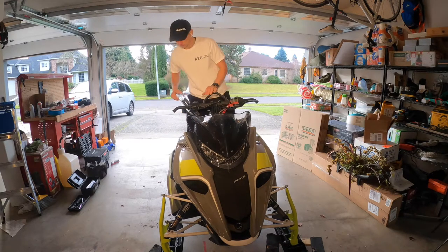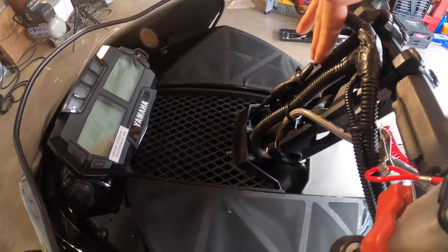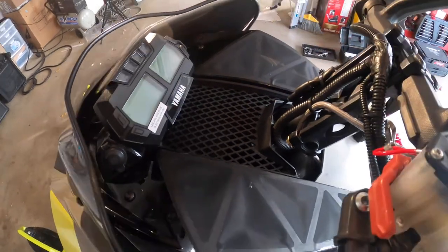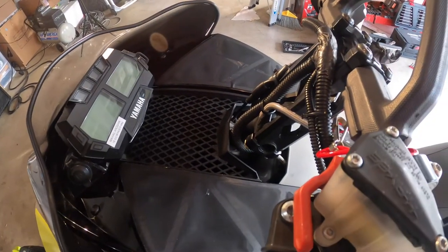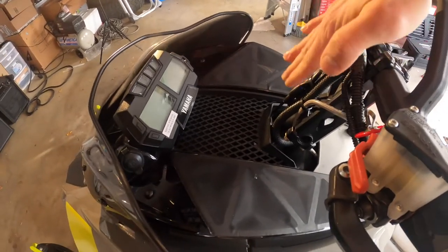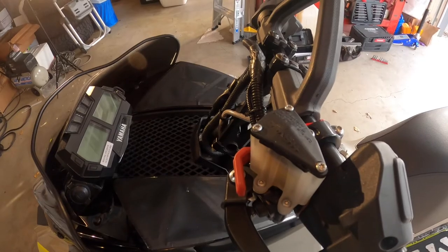Stay tuned. Not sure if you can really see it, but what needs to happen here is the riser needs to be parallel to the shaft. If it comes at any less or more of an angle, then you'll have an issue of feedback in the handlebars. The first thing to do is align the riser with the shaft and then watch the height, if the height is proper or not.